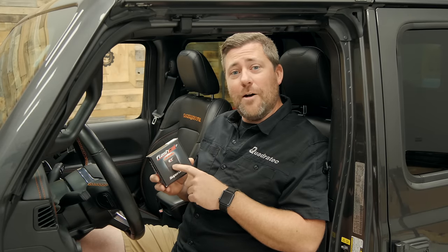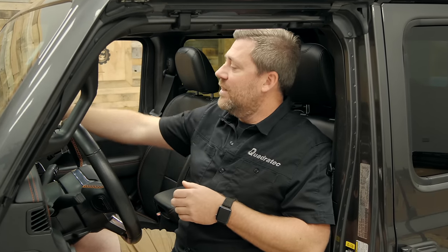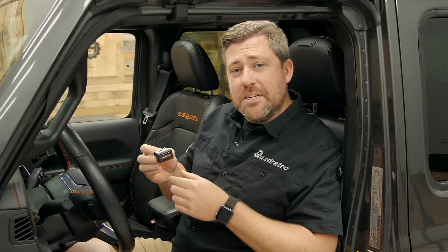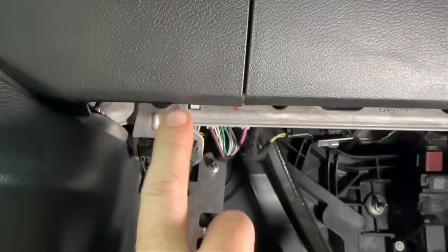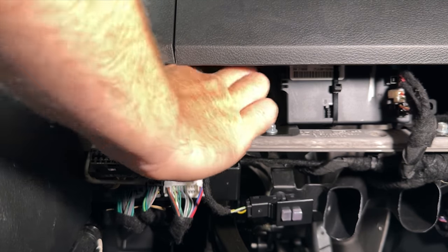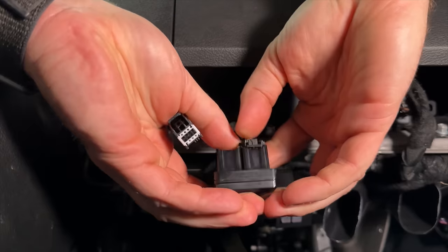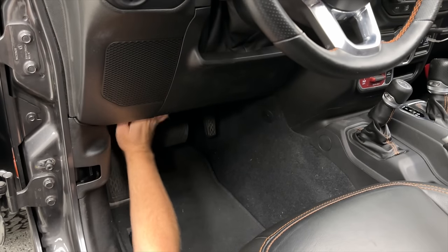Before we dive into all of the features, the first thing we need to do is get it installed in the vehicle. Superchips has made that extremely easy. The Flashcal Plus for the Jeep Wrangler JL and the Gladiator JT is made up of two modules. The first is this small Powertech bridge or gateway module, which plugs in under the dash, replacing the secure gateway module from the factory. You'll reach up under the dash just in front of and above the OBD2 port by your left leg, depress the tabs on the plugs, and remove them. Since they're different sizes, you really can't get the process wrong. Align them with the two ports on the Powertech module, plug them in, and tuck the module back up under the dash.